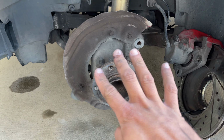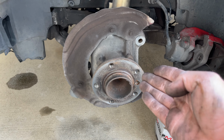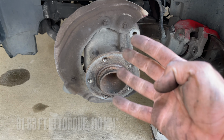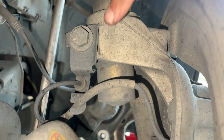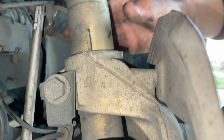And now from here, we're gonna have four bolts that are holding this thing in. They're torqued on to a very tight value. I think it's 110 foot-pounds of torque. But yeah, we're gonna show you where those four bolts are. So you can see one right there, there's another one that makes two, three up there, and then four. And one of those bolts is actually covered really inconveniently by this part of the strut. So we're actually gonna need a strut spreader.